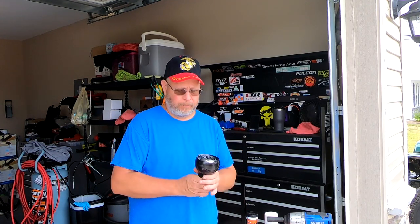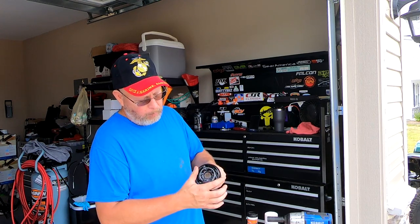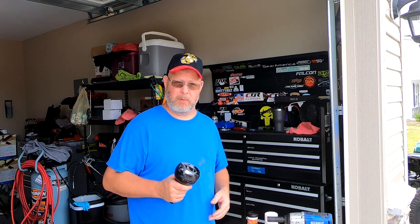The RCV is a CV joint. Inside this barrel, you've got six ball bearings and it rotates around on this race. So when you turn this at full lock, you've got six points of contact and it's much more smooth. It does away with the Crow Hop. You won't get any binding with these RCVs like you do on a U-joint axle. These JL Dana 44 RCV axle shafts are rated to be stronger than the OE Dana 60 one-ton axle shafts, which should alleviate any questions about strength in your drivetrain on your front axle.